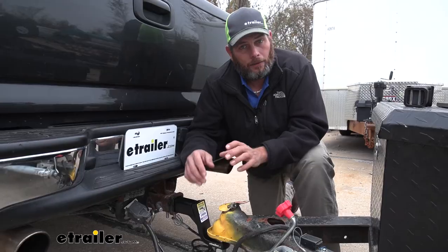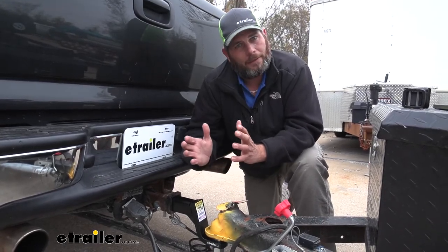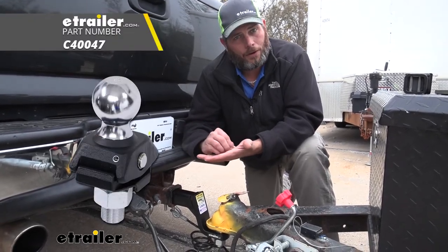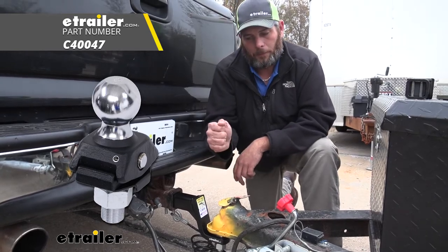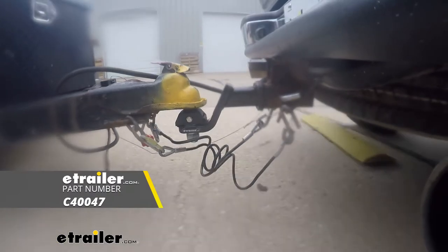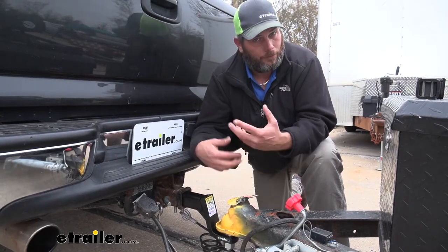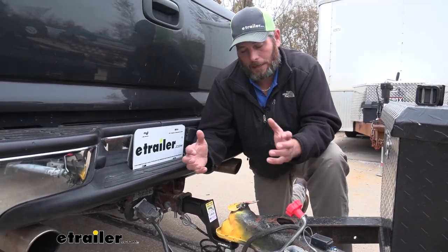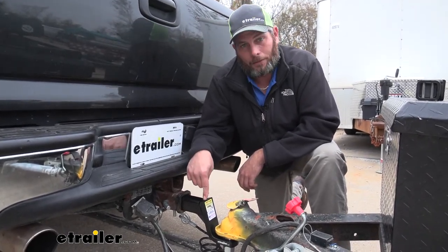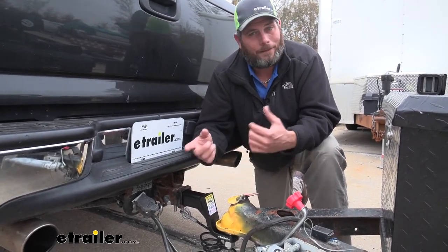Now there's another style that's out there — it's not a cushion ball mount. You don't necessarily have the cushion in the shank, but what you do is use a standard ball mount and add the Curt rocker ball to it. That has a pivot point that allows the ball to move forward and back slightly. I've been working with that one for about the last week, and I wanted to bring this one back out to get you guys up to date with the options. I would definitely recommend the convertible over the rocker ball — this one just seems to be a little bit more effective.